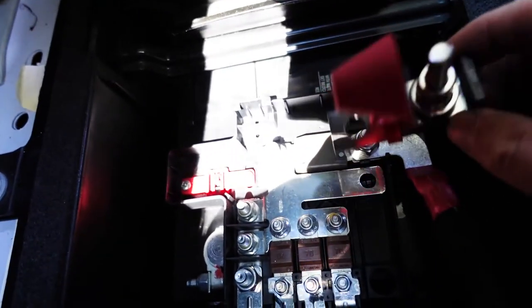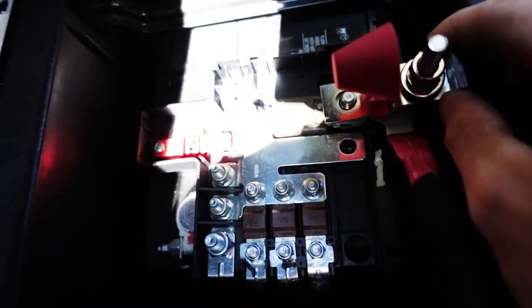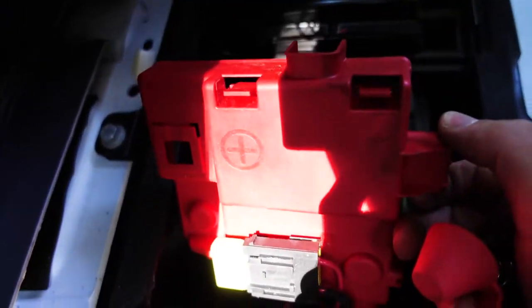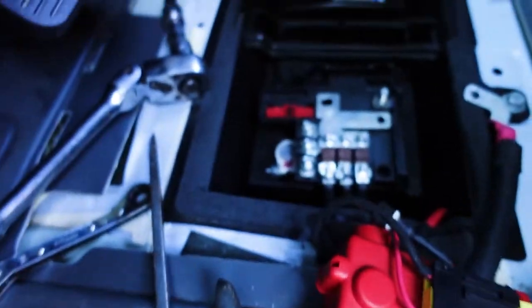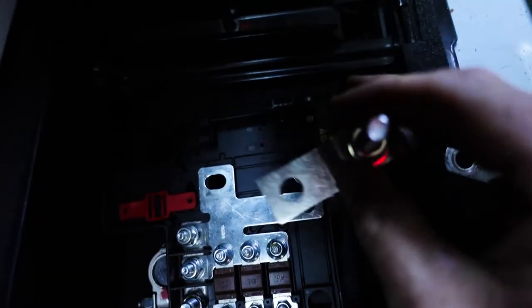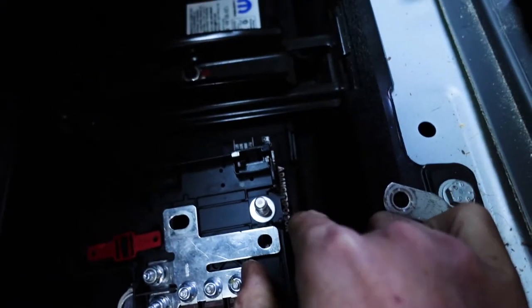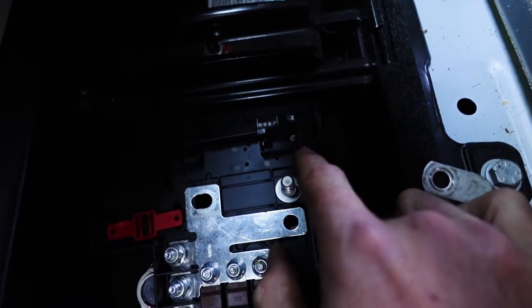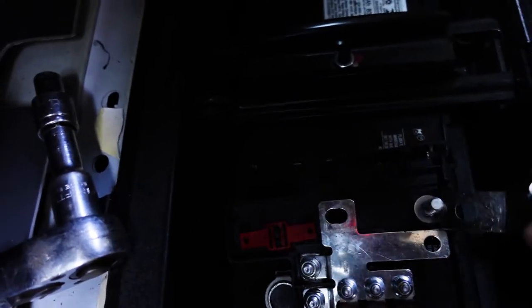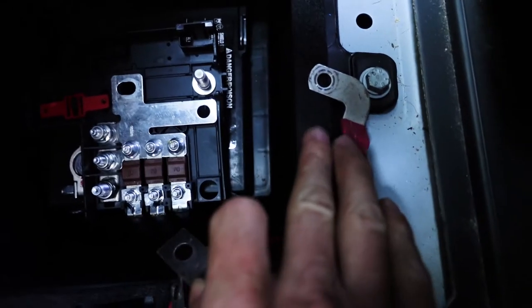While we're waiting, I'm trying to find a place to put this terminal fuse block. Thinking about putting it right here — I'll undo this and slide it up under it and hopefully have the clearance. We might have to modify this little cover a bit. We have the main fuse that protects the van pulled out right now and we're going to slide this on under it, but this little plastic piece is keeping it from going down all the way. So we're going to cut that out a bit and see if we can get it to go all the way below this.